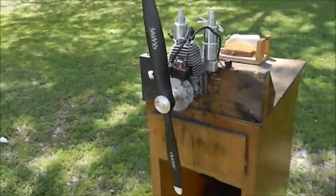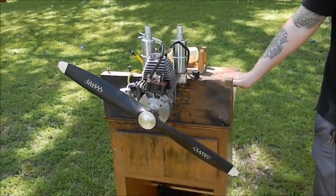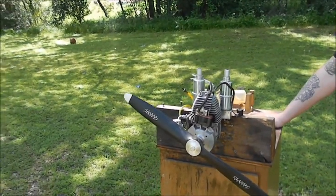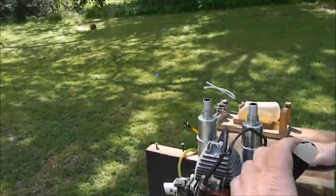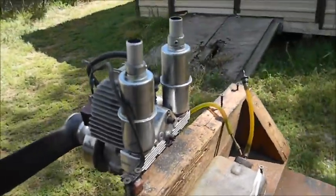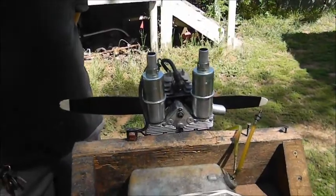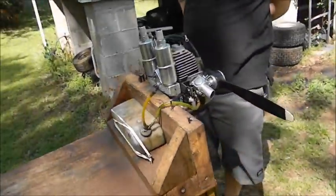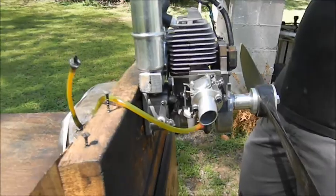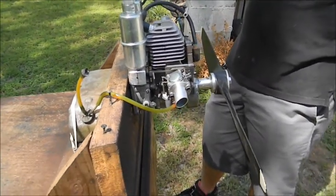It's about to pull itself off that piece of wood there. But there you see it — US 41 CC, turns a 2012 propeller like crazy, no broken fins, straight crankshaft, cool J-Tex muffler — I've never seen one like that before, but somebody put what look like lawn mower baffles on it to quiet it down a little bit. It's got a real nice heavy-duty throttle bell crank setup with a velocity stack, a new Champion resistor spark plug, 41 CC's, ready to go — and it's for sale.